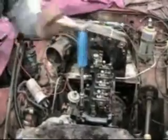We're just about done with our nine studs here at 15 pounds. You can see that I've gone out and started at the middle, and it formed a spiral if you were to connect the dots — it turns into a rounded kind of deal. We went out like that. So I'm at 15 pounds; my next setting is going to be 25 pounds.